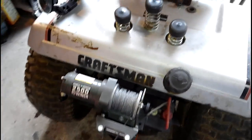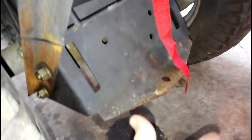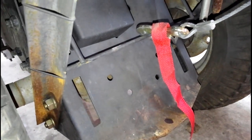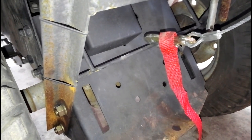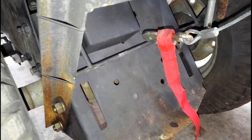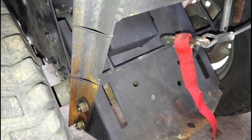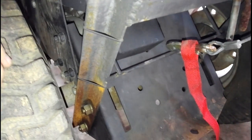First, you're going to need to get to the solenoid box. If you've already installed it, you're going to have to disconnect it and make sure you have enough wire lead so you can get it out to somewhere you can work on it. The way this tutorial is going to go is to make it so that you can actually disconnect the switch from the box — it's not going to be completely hardwired — so if you have to take the switch off or move the solenoid box, that's one less set of wires to wrestle with.